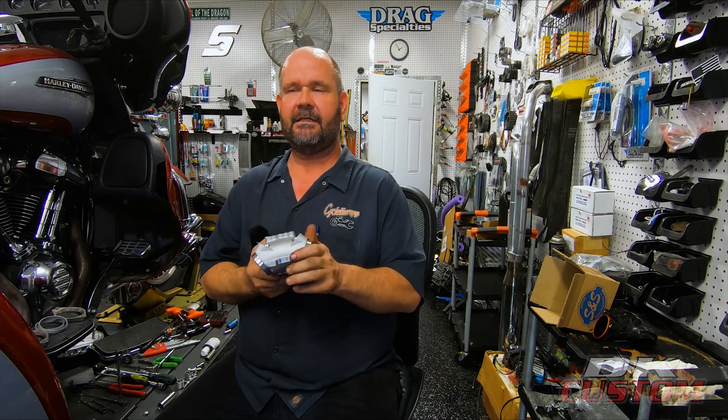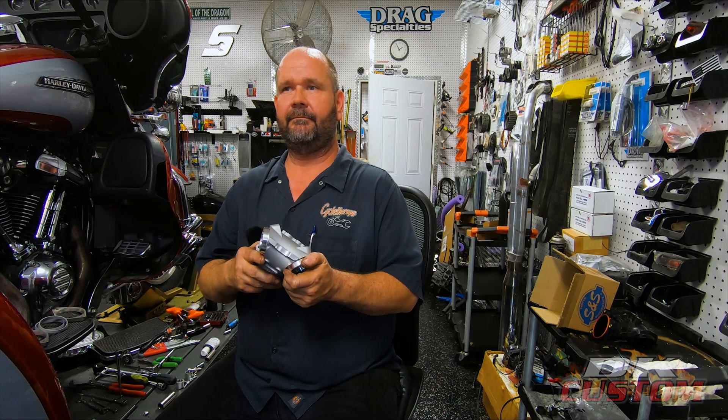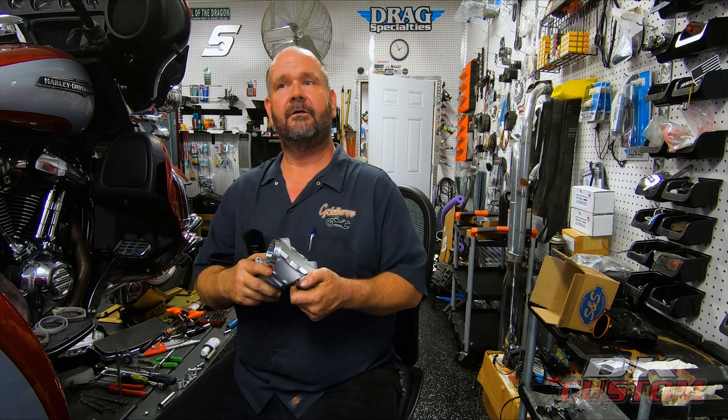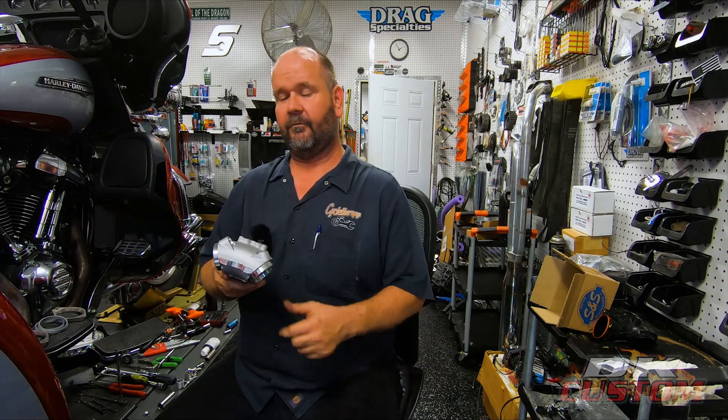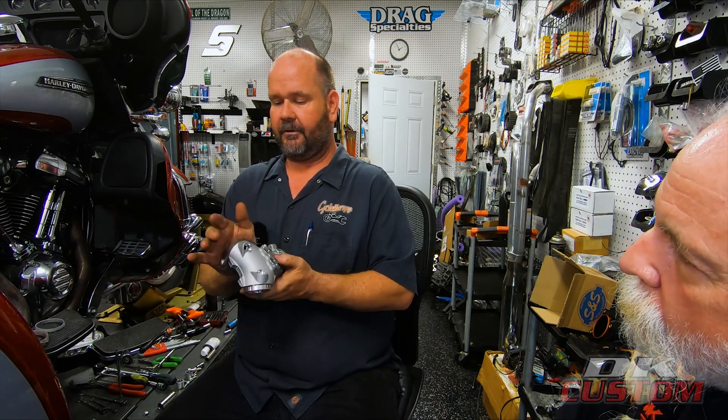This is something that will save the life of your engine and cut some of the heat out. There's no reason for plastic to be in between the two cylinders on an air-cooled motor, or even a water-cooled motor. It didn't work for Cadillac when they ran plastic intakes, didn't work for Chevrolet, and it sure ain't working for us. As for how it helps cooling — you've got a heat sink. The aluminum will absorb more heat. That's part of what happens to the plastic piece — it absorbs heat to the point where it melts. The aluminum will not do that. There's a reason every Harley had an aluminum intake until the M8 came out, and they definitely don't run any cooler — that's been shown in testing.